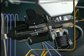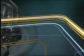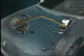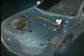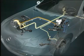When the brake pedal is operated, the pedal travel and the pressure in the brake master cylinder are recorded by the SBC computer. The computer transmits the brake command to the ESP control unit. The control unit then determines the optimum brake pressure for each wheel. The result is reported again to the SBC computer.